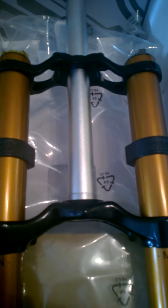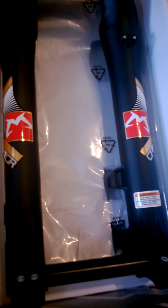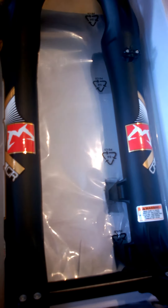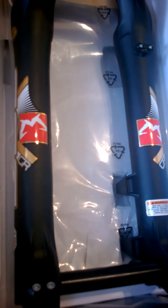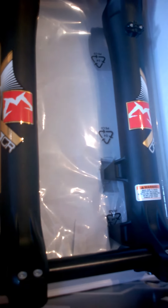It's a 1-1/8 steerer tube — the non-tapered version — so it's going to be compatible with my setup. 20mm on the bottom for the wheel, which is pretty standard these days. The rotor mounts — you can see the post mount there. I'm fitting a set of Hopes on the front of this. The technical documentation states it will take up to a 229mm rotor, which is a huge dinner-plate rotor, but I'm sticking to a 203mm on the front.